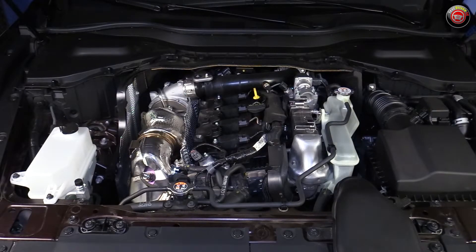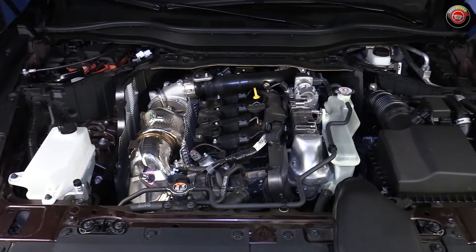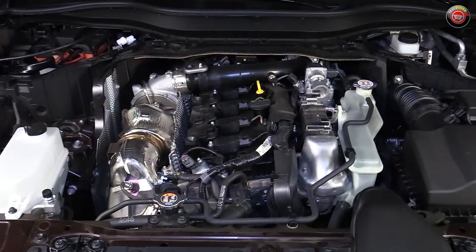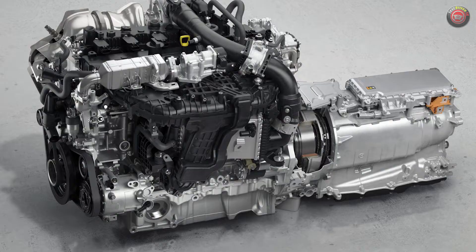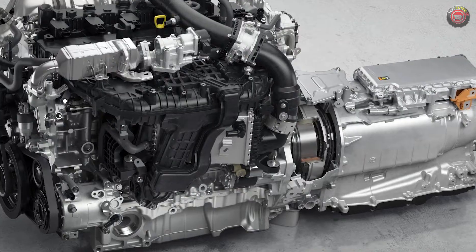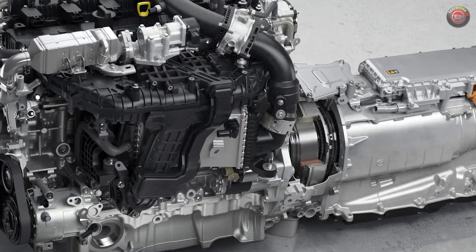Getting to actually see the engine and the engine bay's vital organs requires the removal of multiple layers of cover panels. Once free and clear, we can see this new gem. The inline-six is the first from the brand and their most powerful production engine ever. It's mated to an eight-speed automatic transmission and features a 16.6 horsepower electric motor between it and the engine. In lieu of a torque converter, a set of electronically controlled clutches manage all of the power transfer.